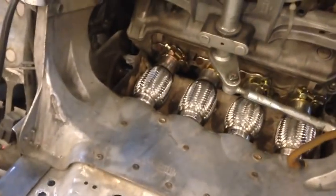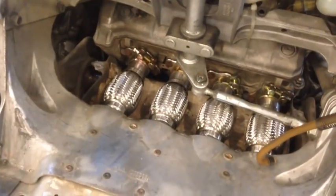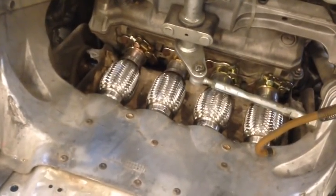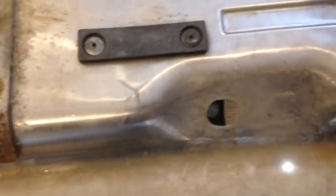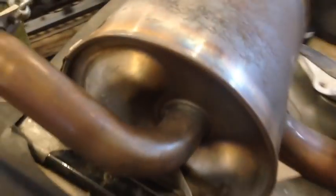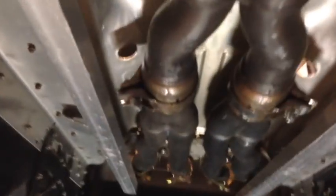Okay, after all that test fitting, sanding, and a little grinding on the pipes just to get them in nice and smooth, those are in there. Just line all my bolts back up. Put my can back on. You always tighten your can first. And you go up to your clamps, your joining pipe, and secure those. And then there's the clamps underneath.